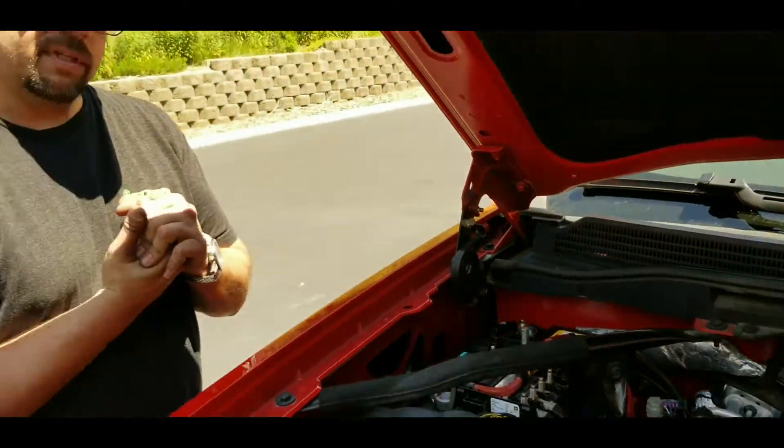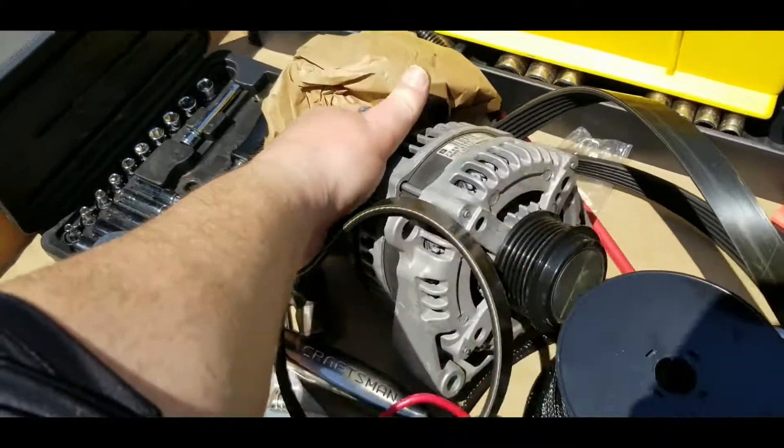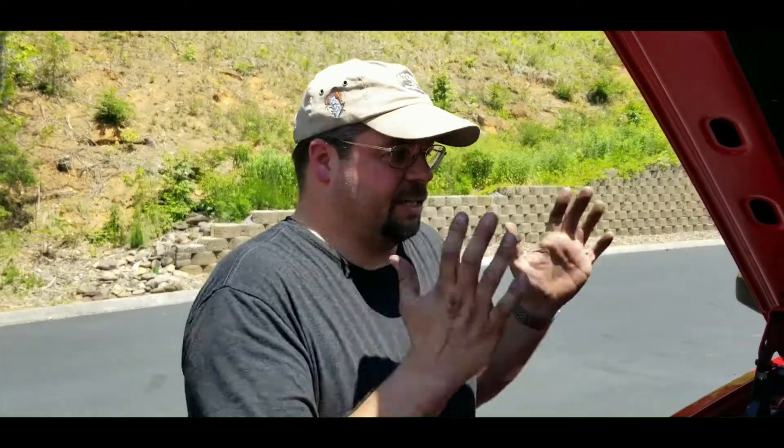You may not notice it with a stock alternator, but your voltage will fluctuate slightly, very slowly, because the alternator is not very big — small case. When you install the bigger alternator it can fill that battery up much quicker, so while you may see your voltage gauge go from 12 to 15 volts — 15 when cold, 12 maybe running down the interstate — that is normal. That is the way GM intended it; there's nothing changed, you're still getting what you need.